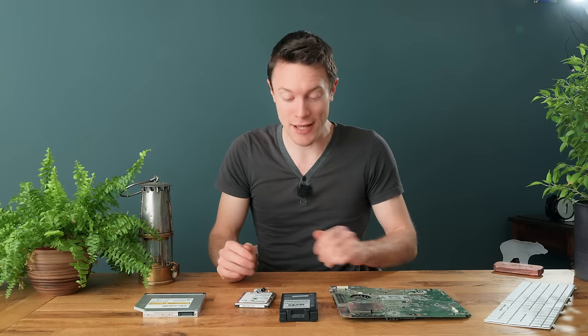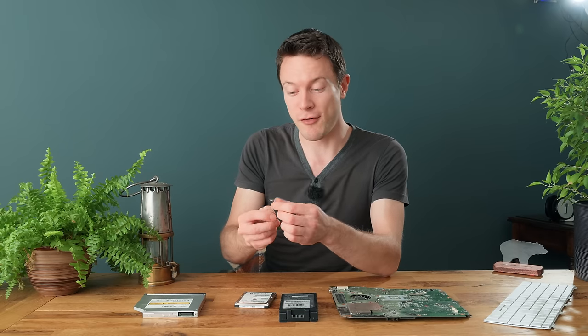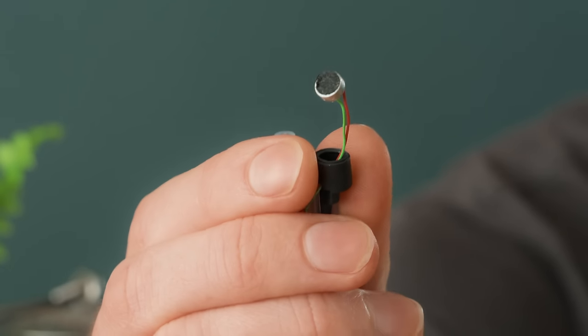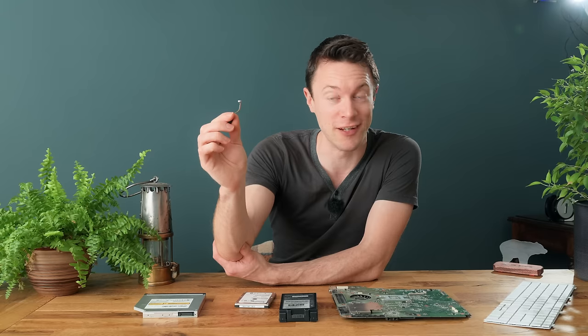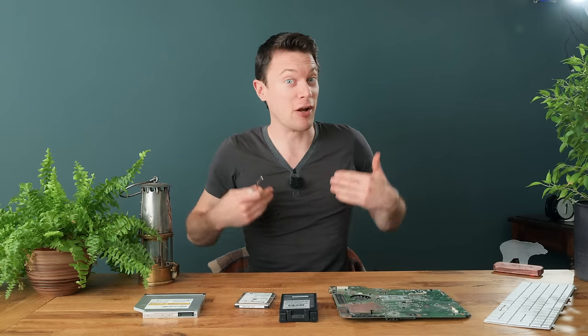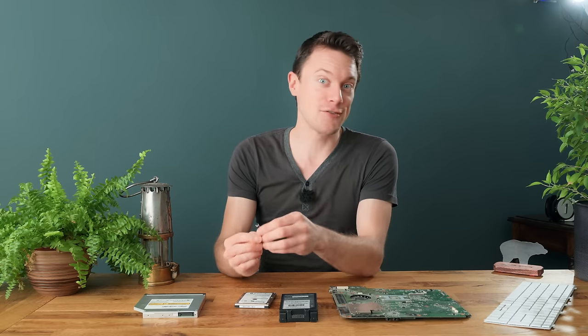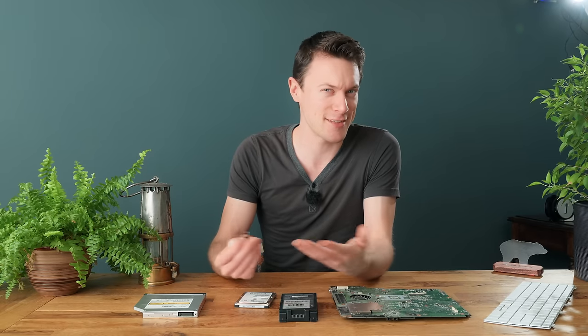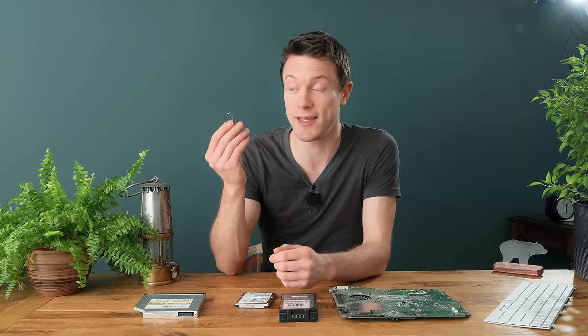Now the next project requires one of the smallest discrete components you can find in a laptop — its location can vary so you will have to do some hunting — but what you are looking for is a little cylinder with two small wires attached, and this is in fact a microphone. Now these can actually sound very good; proof of which is that the little lavalier microphone I'm wearing right now was made out of a laptop microphone disassembled several years ago, and it sounds so good that I've used it in almost every video I've made since then.